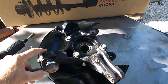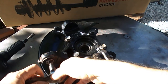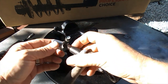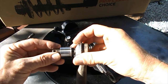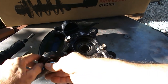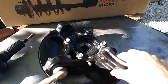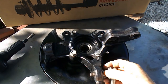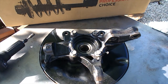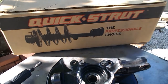That tapered insert drops into the seven-eighths-inch hole, and the Honda Ridgeline (same as Odyssey) tie rod end goes right in. Once you tighten the nut, it sucks the tie rod down and the sleeve — which has a slit in it — expands inside the hole, making it much tighter than if it were a plain hole. That's the passenger side setup so far.